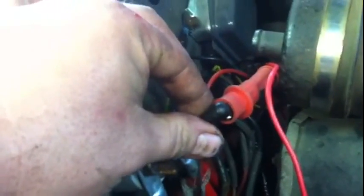This is the wire that comes up from the neutral safety switch — my meter's on it. The other side of my meter is the ground. That's just a jumper because my meter lead wouldn't reach. Here's the other side of my meter lead connected to that jumper. Now we'll get in the cab. I got the meter set up against the windshield so hopefully we can see it.